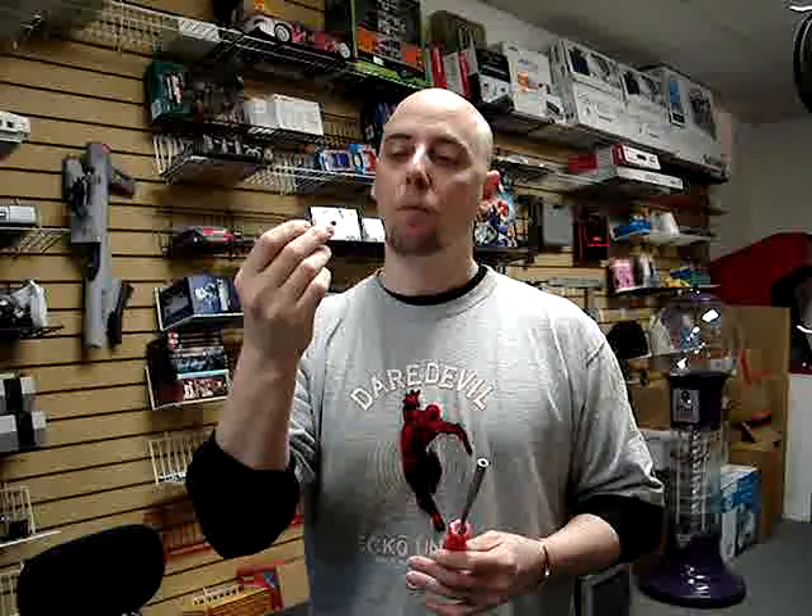Taking your systems apart is really actually very easy — don't let it intimidate you. Once you do it a couple of times, it's really pretty easy. Most old school systems use a Phillips head screwdriver. Old Xboxes and the 360 use a star bit, and Nintendo's are the ones you really have to watch out for — they use what is basically called the Nintendo security tool. You can jump on eBay, search for that, and these things will come up by the dozen. You can get it shipped to your house for next to nothing, throw it on your screwdriver, and you can take apart Super Nintendos, GameCubes, Nintendo 64s, whatever. It's a must-have if you want to do a Nintendo console.